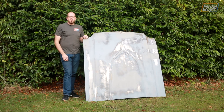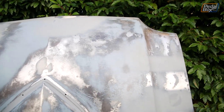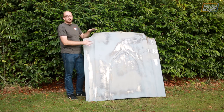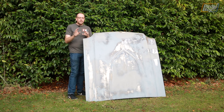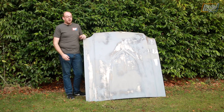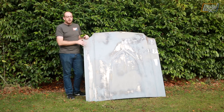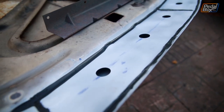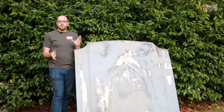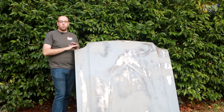That was over two and a half months ago. We have done some more work — most of that grey primer we put on to protect it while on the car, we've taken off again. We did that when we were sanding it down, getting it smooth, and actually fixing most of the dents in the bodywork. We've tapped them out as much as we can, and there is a little bit of body filler on it. You just can't get replacement panels without having a 300-ton press. So we took this to a place local to us called Car Savers near Farnborough — they were really, really good. They're a welding specialist and they actually filled in a panel on the underside that was completely rotten. We thought about a couple of different ways to do it, including just getting another bonnet, but shipping it over was far too expensive, and getting it fixed was way, way cheaper.